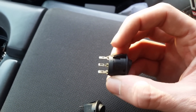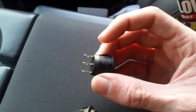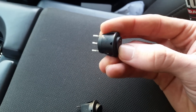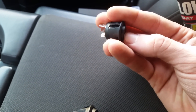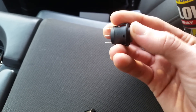For this switch, one contact goes to your high beam trigger wire if you want to trigger it from the high beams. The other contact comes straight from switch power, just like the old one. So when it's in the high beam position it triggers from the high beam, and when it's in the other position it runs straight through switch power and turns the light on independently.